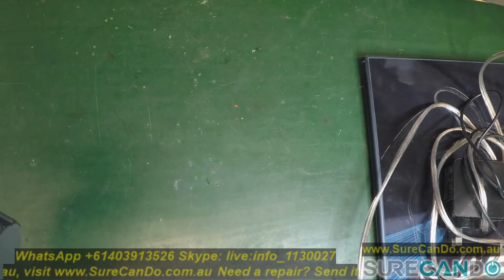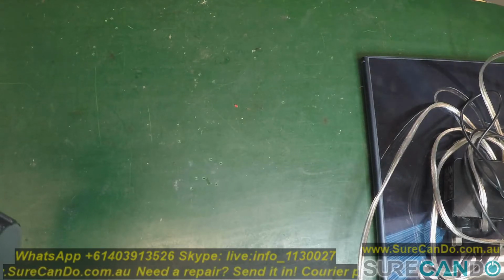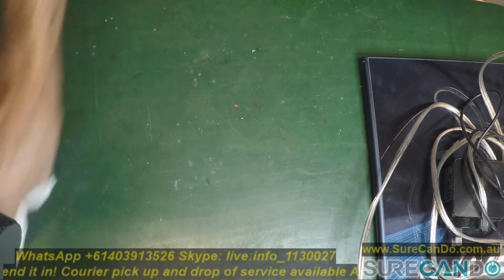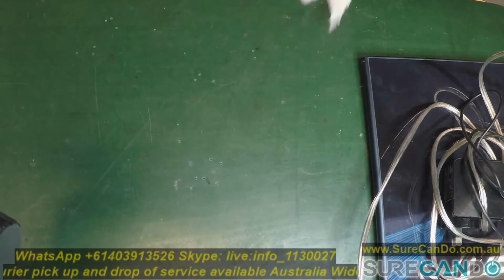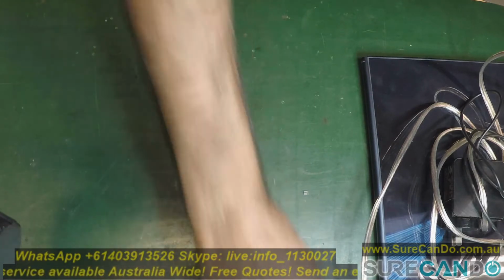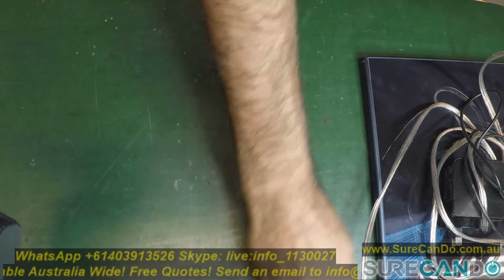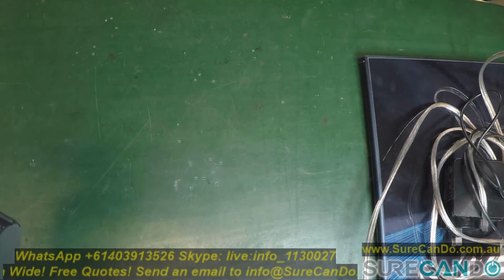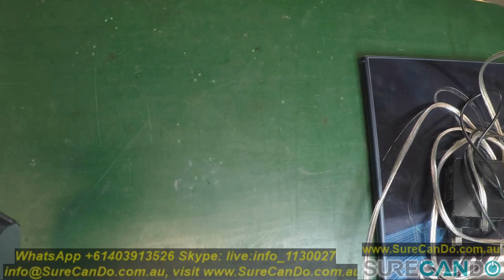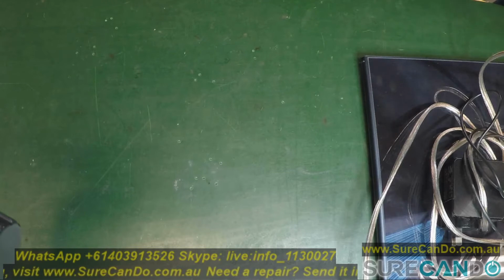Here is a dilemma you might face later on. Basically, I need to update the BIOS on a laptop. This is the ASUS UX301LA, and I cannot update the BIOS. The main reason is that the battery inside has the permanent failure flag triggered. It will not take any charge, so the only way to flash the BIOS is to get a new battery, charge it up more than 20%, and then you can flash the BIOS.